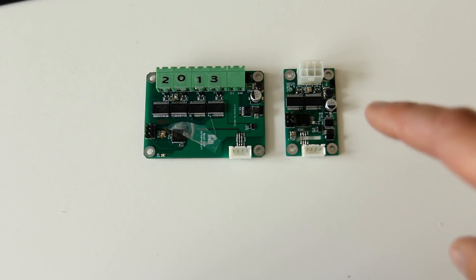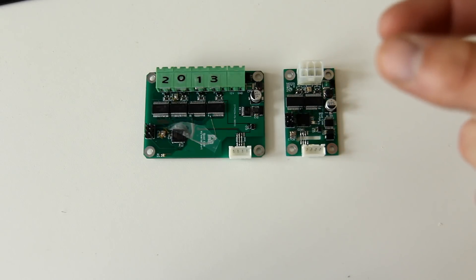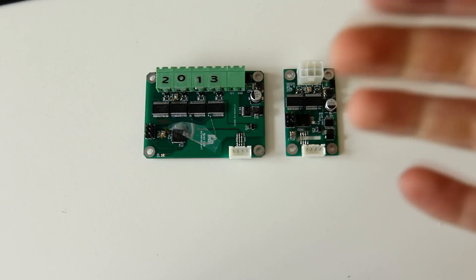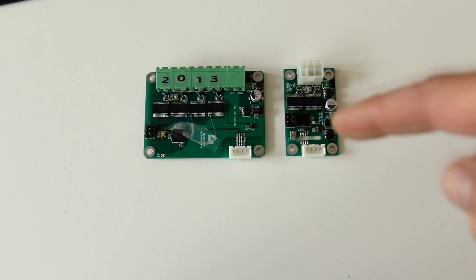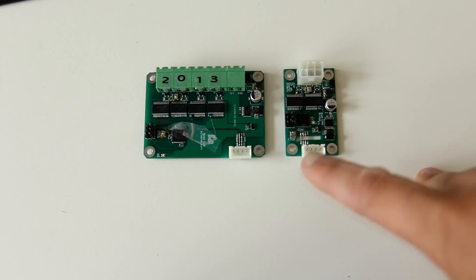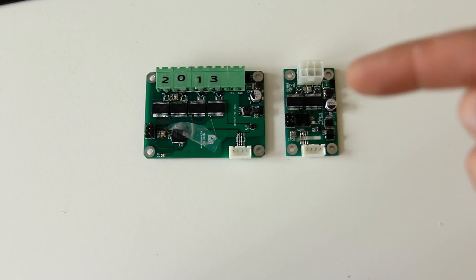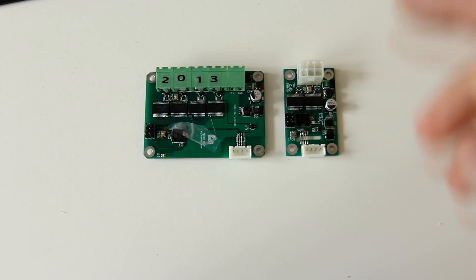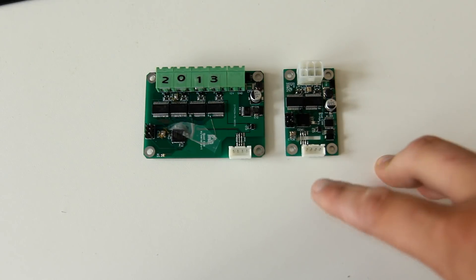If you put this on an existing CAN bus — you snip the wires, you put one end in one bus and one end in the other bus — as far as that bus is concerned, nothing has happened. It just seems like there is a little bit more delay in the wire. However, what I can do with this is intercept messages and either just not send them at all, which means I can block certain messages from going through the bus, or I can modify messages.